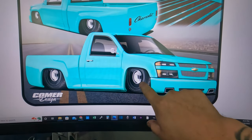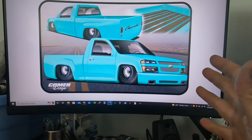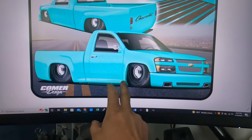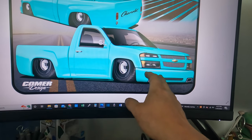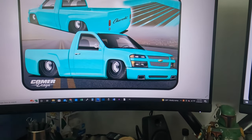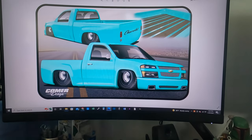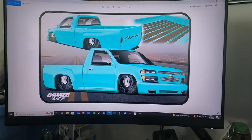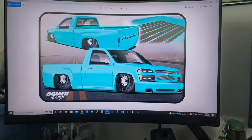I'm actually using an S10 frame. I already purchased the front suspension — I don't have it on hand yet. I want to build from the firewall back, and from the front frame horn back to the suspension I'm going to cut off to make it fit the Colorado. The engine is going to be a 250 inline six — I already have it. I may do a manual transmission, but I do have a 700R4 already and I'm planning on using that for now, though that could change later.